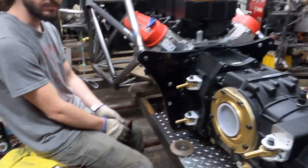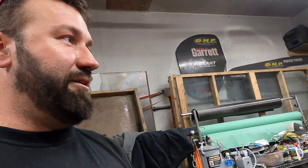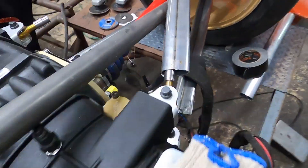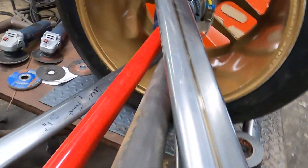I like to scrape off all the mill scale. Next up, let's get the wheel and upright set up. Looks like tonight I'm going to have the A-arms hanging, then tomorrow we fixture the A-arms and build the other side, weld them all. If we had suspension by Monday this thing would be rollable and steerable. All kinds of stuff going on - I built the lower control arms, you guys have seen that on the front suspension episodes. Now I'm figuring out where the push rod is going to go, which goes up to the rocker.